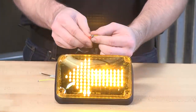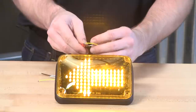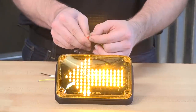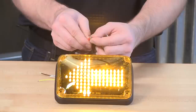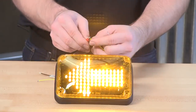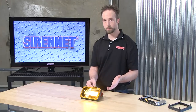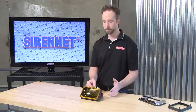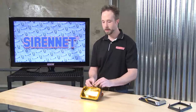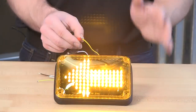As you can see, when the arrow is fed power, it will go ahead and do a slow pan across itself. Reconnecting and using the ScanLock trigger wire, you can see that the sequence across the arrow has now sped up. With another adjustment, the arrow is continuously panning across itself. In a vehicle where there may not be a conventional OEM blinker circuit — a specialty piece of equipment, fire and rescue especially — the arrow can be fed a continuous 12 volts and it will pan as needed, indicating the blinker circuit.